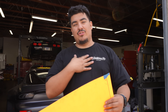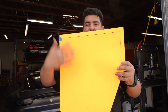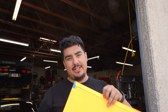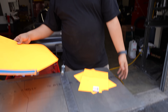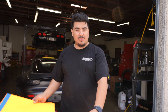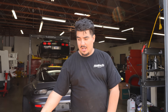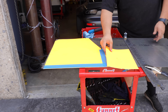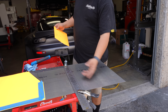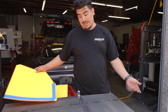On top of that, I drove the car and it was hot — I could feel a lot of heat — so I'm going to make a heat shield to put right over the header exhaust area, so that way for whoever sits in there, hopefully me again. Another cool thing about having a plasma cutter is you can maximize your area for metal and waste the least amount. If not, I'd have to cut on the back and it gets all weird. I put my templates on here and with the extra metal I'm just going to cut this off straight, so I keep this piece for something else and maximize all my metal.